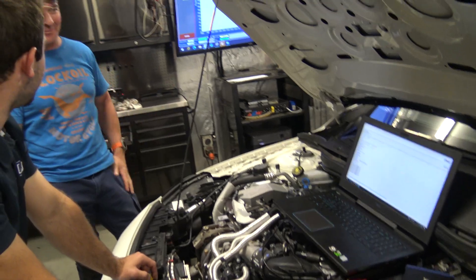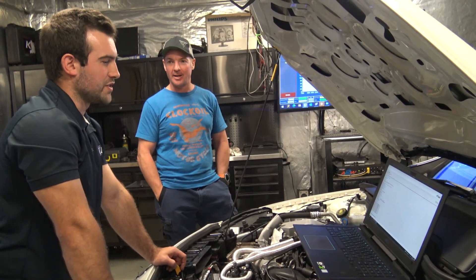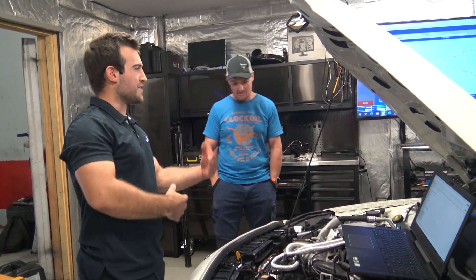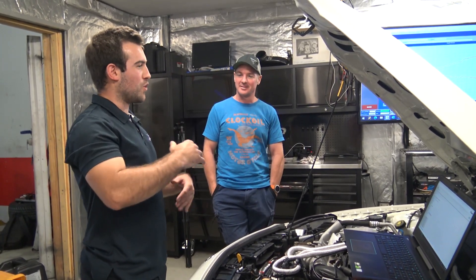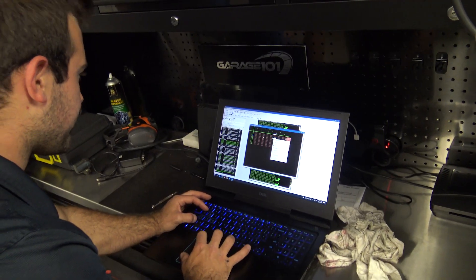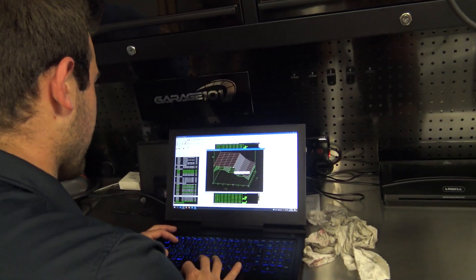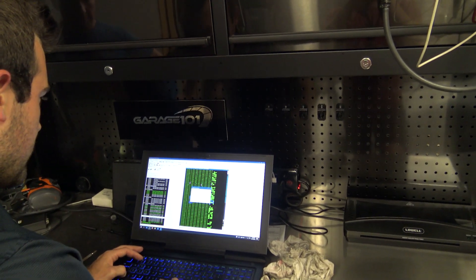Race start is a novelty thing anyway. Like we lowered it quite significantly before but it had a lot of bogging down - we tried at Equinata Motorplex where we lowered the race start and tried to reduce wheel slip. It did do that, but it didn't generate enough power to overcome the force of having to move the drivetrain, so it bogged down and wouldn't make enough torque to get it off the line. You're playing with power in the tune and trying to figure out the race start set point - it's a harmony balance of where you can make the most torque and lay it down correctly depending on engine speed. So for first gear, maximum torque is going to be 600 newton meters, whereas before it would have been 400, increasing up to 500. But 600 newton meters is where I'm going to set it.